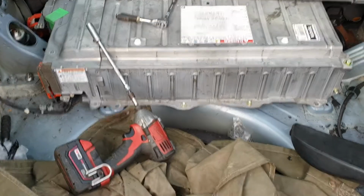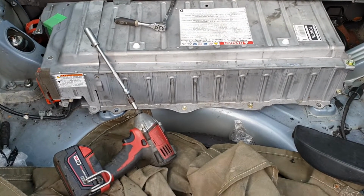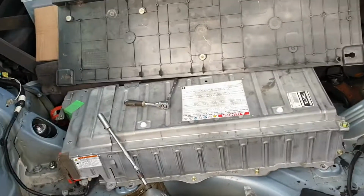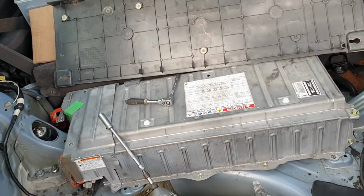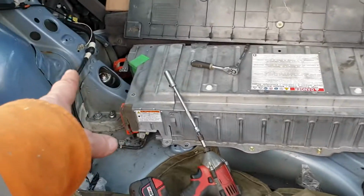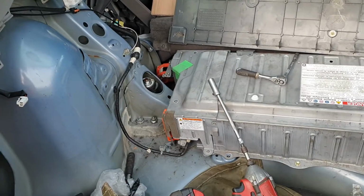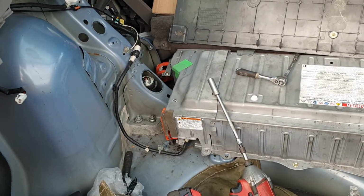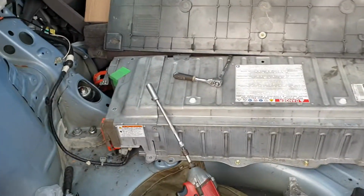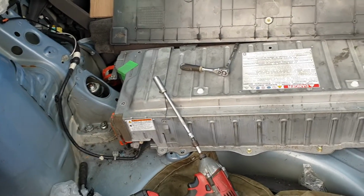So I've just got to pull it back together now. So yeah, and I think it's got to go back the way it has with every bolt, because it almost looks like that's a structural piece when you put all these frames in. So obviously they work it all out on a computer, so every little stress and tolerance is monitored. While I'm in there, I might just put a couple of blobs of grease on top of those mounts, just so that you have an easier job, or anyone else does, if they have to ever drop the rear sort of shock mounts there, because I've had to do springs and stuff and shocks, and they were bastards. So I'm just going to put a blob of goo on there as well.